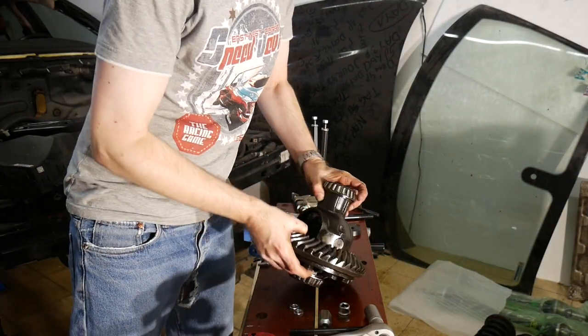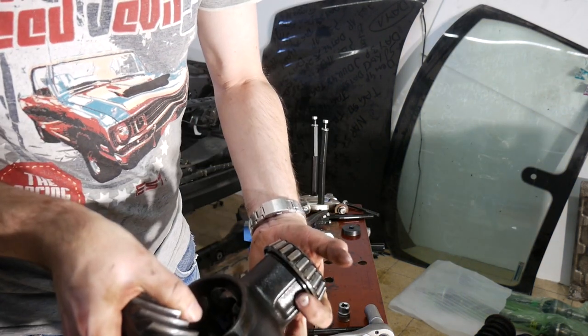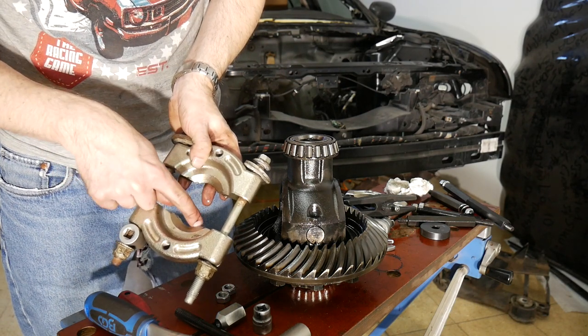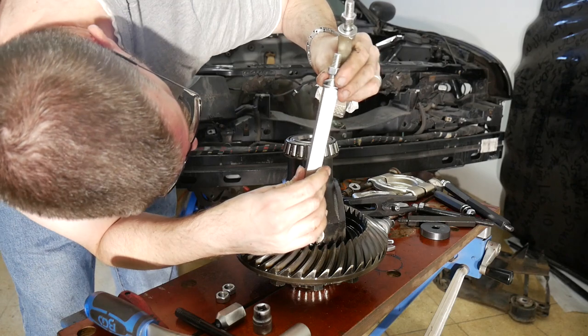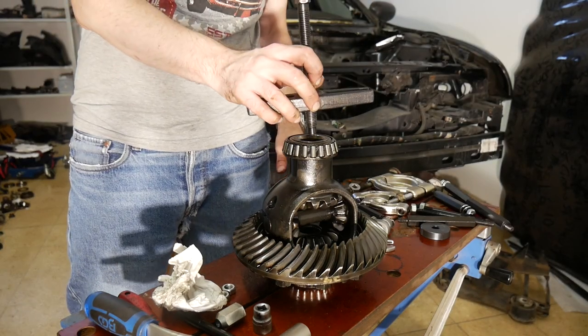Now up to the bearings on both sides of the gear carrier. The carrier itself has cutouts on both sides. Those cutouts make it even more difficult to use my splitter, because this has a rounded surface exactly in those areas, and that's why I decided to try the standard two-legged puller on this bearing to counteract the pressure.